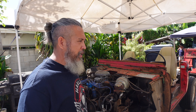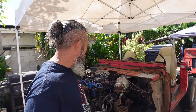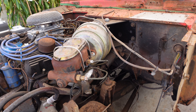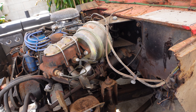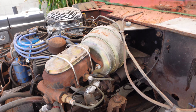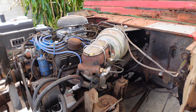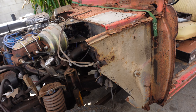We moved it under the tent and then took off the hood. First order of business is to take whatever off, going in order and saving as much as I can. The steering column needs to come off, and to make it easier I'll remove the brake booster mounting. The brake lines still look to be in good shape, and after that I can take off the front cowl and lift off the body.